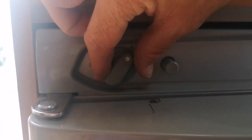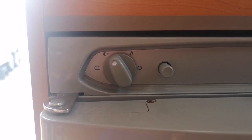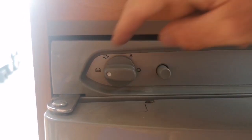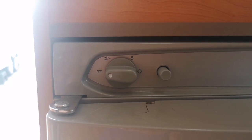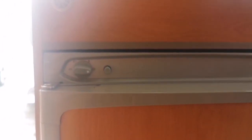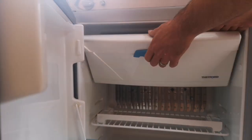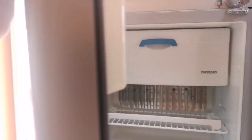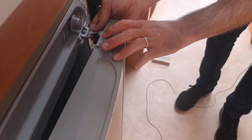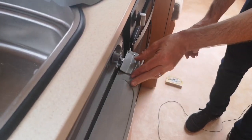If you want to run the fridge on electric, just put it to the plug sign. If you're in the car and want to let it cool down, it will only cool down - it's not going to work like it does on electric or gas. Pop it onto the battery symbol and that will run on the car if your car is wired to do so. Once finished with the fridge, always pop it back into the off position. If you're not going to use the fridge for some time, it's advisable to put something in to hold the freezer door open. There is a little tab on the fridge door that hooks underneath to keep the fridge ajar. That will then slide back in and close as normal.